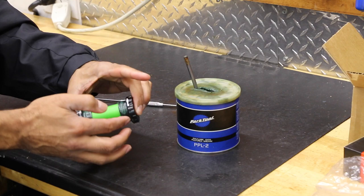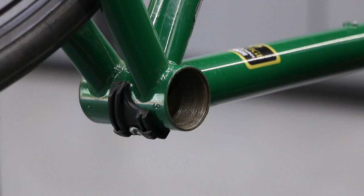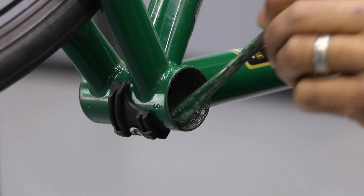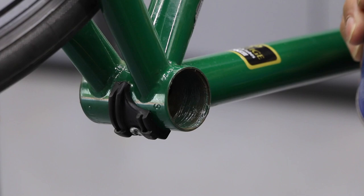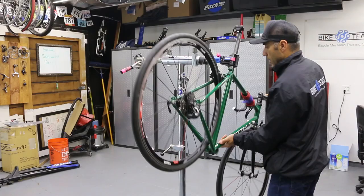Now we're going to apply the same amount of grease on the bottom bracket shell of the bike. Be pretty liberal and get that grease in between every single thread. The threads are approximately an inch to an inch and a quarter wide — just get those threads, not the entire length of the bottom bracket. We do a section on one side, section on the other. If you have a bike stand, you can always rotate the bike upside down to make things easier.